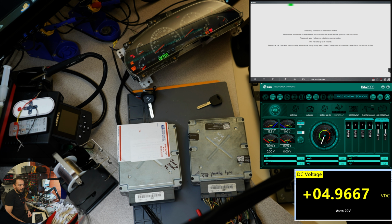So even though the anti-theft is on, if I go over to the fault codes in the anti-theft, we will see a PCM verification not done. We should always see RPM on the cluster, and I'm going to show you that. I'm not sure why it's taking so long to connect. I mean, this is on. I'm going to plug it from here one more time, if that helps. I just heard a beep of connecting Bluetooth-wise.